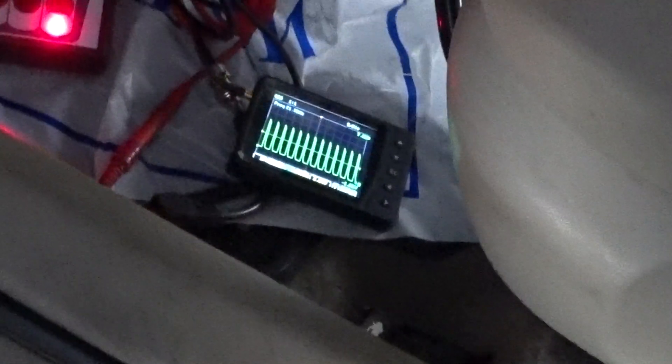So I look in there, wiggle a couple of wires, and I see a little something right here. There's a little bit of a blue wire and some blue residue on there. When I move the seat up, you can see this metal bar — watch what happens. It cuts my communication. Got lucky on that one, I'm not going to lie.